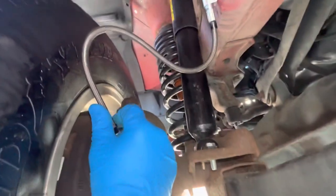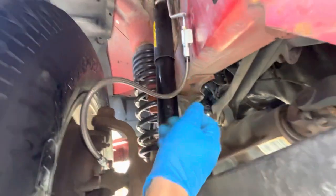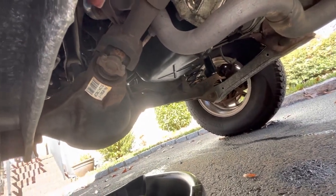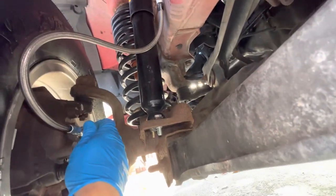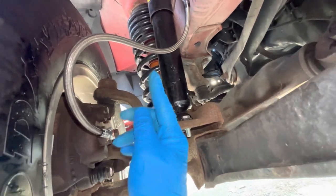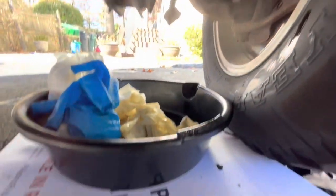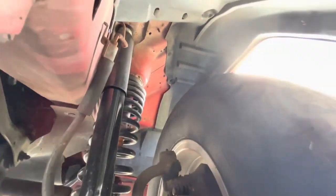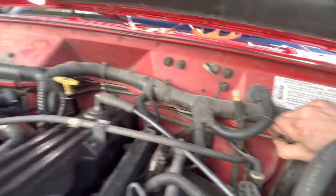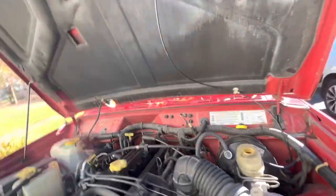You want to keep this away from the tire. To do that, this really needs to be attached up here — you can see the other brake line and how that's hooked up. We'll tighten this down and then move to tighten the top, then move to the other side. The only thing I can't do is attach this part to the fender. I got this brake hose off the passenger side and the banjo bolt is out. I'm going to use the new banjo bolts on this side and start pulling that hose out from various places along the bulkhead where the line is clipped.